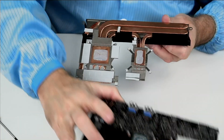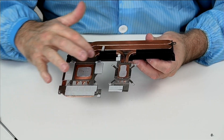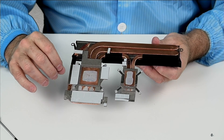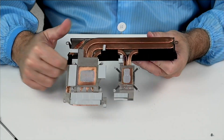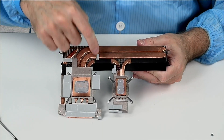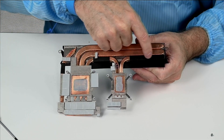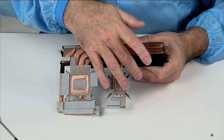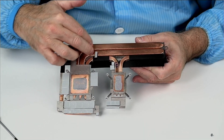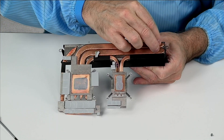Taking a quick look at the cooling solution: you can see that each of the inductors, FETs, processor, and memory components are all cooled by these thermal gap pads. They're tacky — they've got silicone in them and they don't want to release. You can see my thermal paste because I've removed it; now I have gaps in my thermal paste and I'll have to fix that before putting it back together. You can also see that one heat pipe is shared between the CPU and GPU, hitting the fin array. The CPU gets its own cooling area out here because the blower blows its heat out first. The RTX 2060 has two heat pipes that cover about seven-eighths of the entire length.